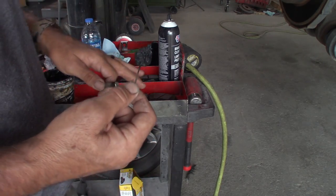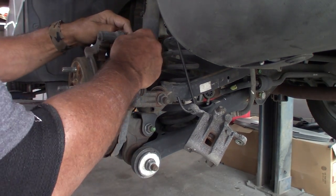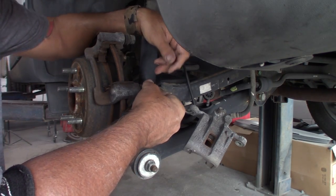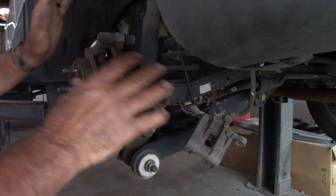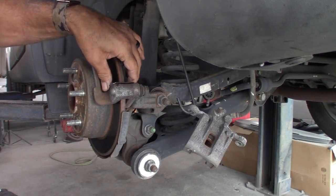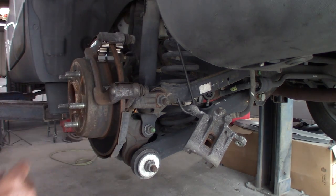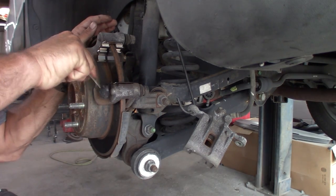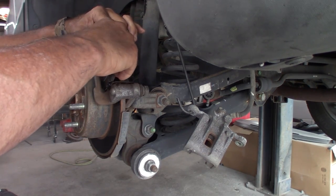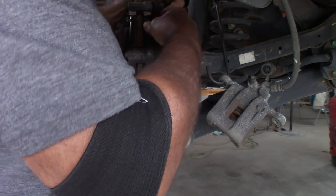When you're going back with your grease, I'm not real specific on what brand I use — just put a little bit on it. I find all of them to be about the same. Put it in, make sure it goes in all the way and the boot snaps around the pin. Now I have seen some cars come from up north where the rust and corrosion on the brakes are just atrocious — there's a whole different process for that. These went on nice and snug. The same thing when you're putting these on — just use a dab of grease right on the end.